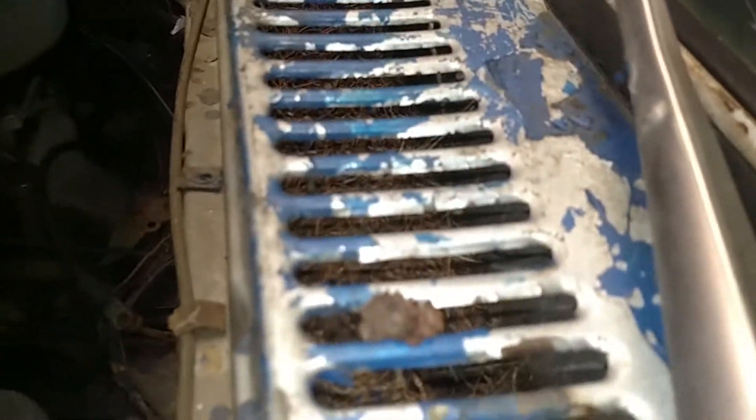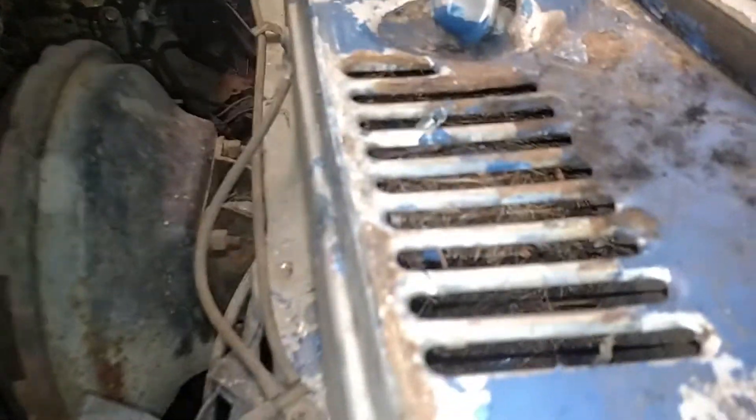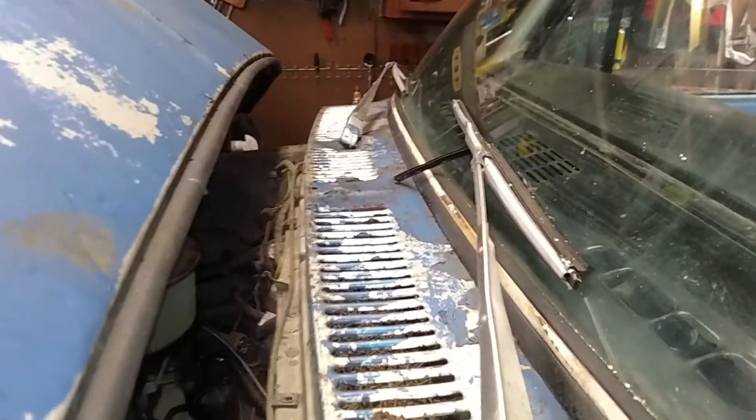I've got another nice little challenge here — see these vents? Can you see all that debris down in there? How do you clean that out? I have no clue. I can't even fit a vacuum cleaner nozzle down in there, and I'm not finding any openings. I found this little plug here but that ain't gonna do nothing. I'm gonna have to look underneath the dash. If any of you guys have any idea how I can get in there and clean that crap out, let me know. That's probably why I never had any heat — it's all full of crap in the vents. I think I'm gonna have to take the dash piece out underneath the glove box just to get in there at the fan.